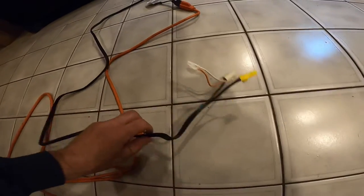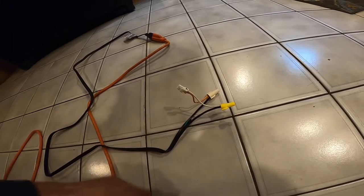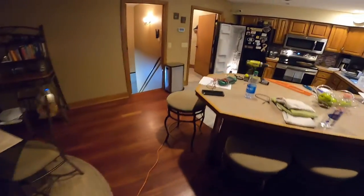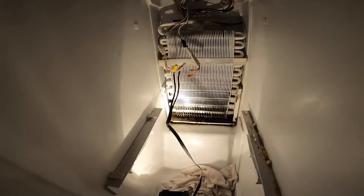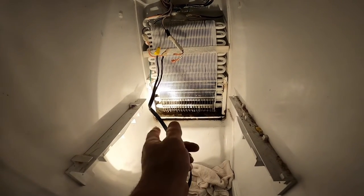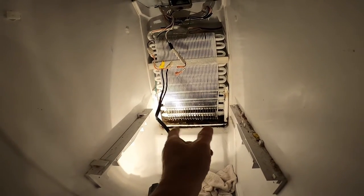So what I've got here is just a lead cord with the pigtail wired right to 120 volts, and I'm going to plug it right into the element. If the element gets hot, then obviously it's this thermostat fella here. I'm going to go plug this cord in — either you're going to hear a big boom, or the element is going to start heating up. I can already see it smoking — yeah, it's already getting warm. You can already see the steam. So the element is fine.